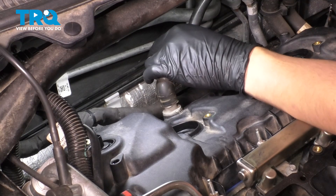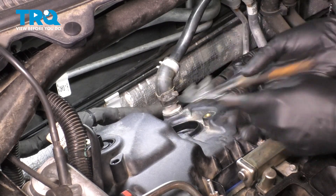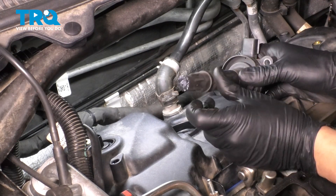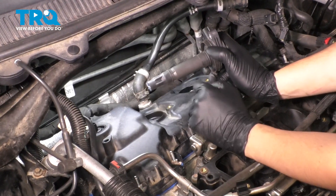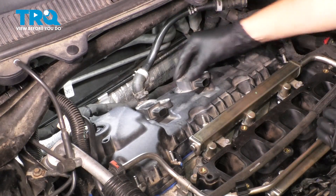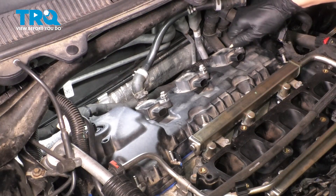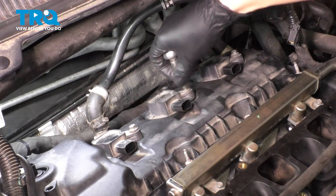Let's get this PCV hose back on — slide it over all the way down, grab the hose clamp with some pliers and bring it down. Make sure you don't put it all the way down where it's going to come off the hose, but not all the way up where it's bending either — like this is perfect. Now we can put the ignition coils in. Before I put them in, I put a little bit of silicone paste on the end. You don't necessarily have to, but I recommend it — this will prevent moisture from building up between the coil and the spark plug and will allow the boot not to get stuck in the future. Put all three mounting bolts in and snug them up. Once they bottom out, give them about an eighth of a turn — that should be plenty tight.